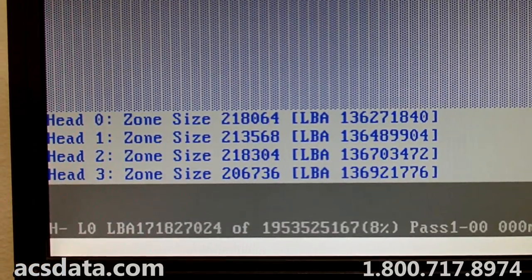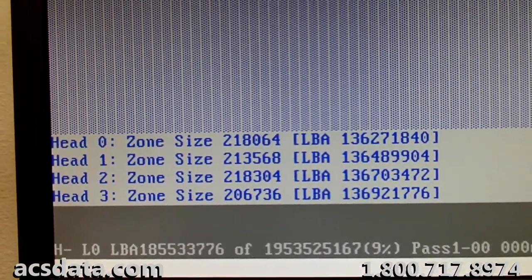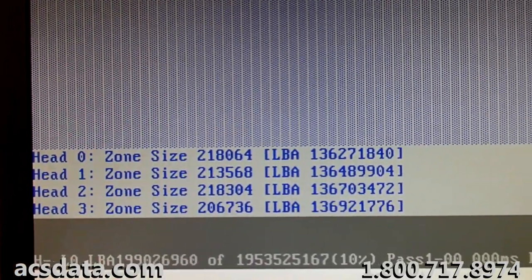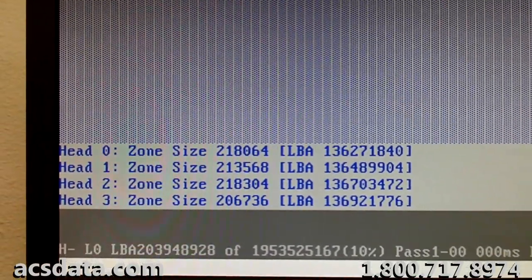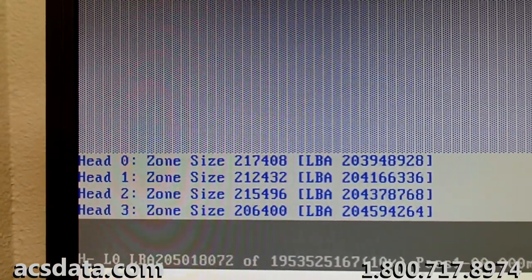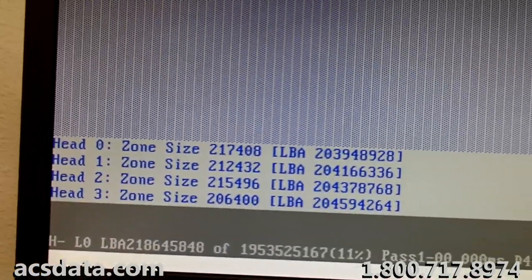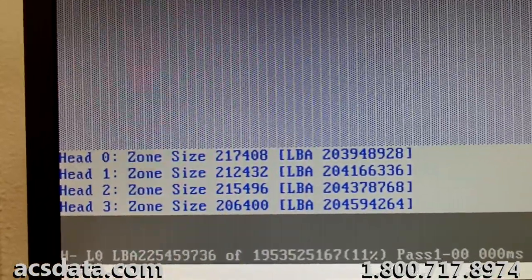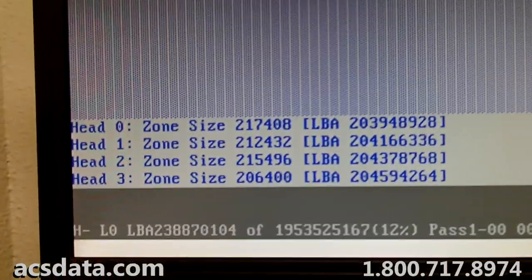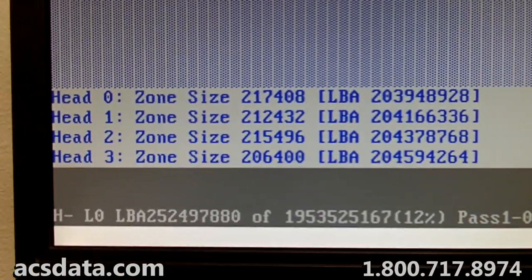But, like I said, right now I kind of just want to go through and get whatever we can off of here. I know that the customer said that they need some files with the file extension DAT on them. So I'm hoping I can go through and create a bitmap on this, and then from there be able to select all the sectors that contain those files. That would be ideal, and just focus on imaging those first and not really doing anything else.